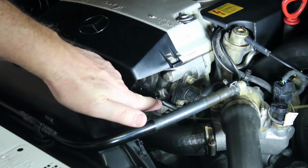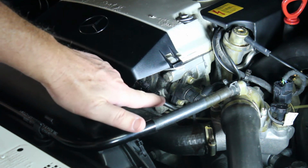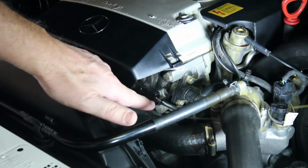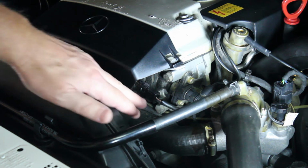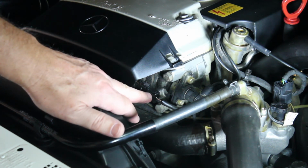So the wires themselves are marked. And then what I did is I took a silver marker to mark the top wire so I'd know which way its relative position was in the plug, so I wouldn't get anything with polarities mixed up. And then I simply replaced this plastic connector. Super easy, and I'll explain that in a few minutes.